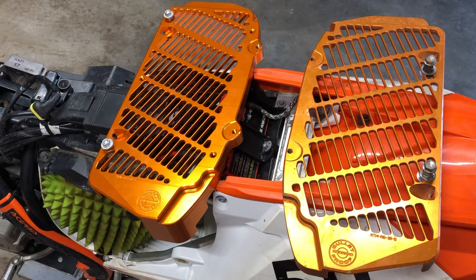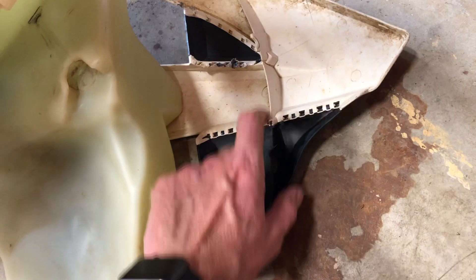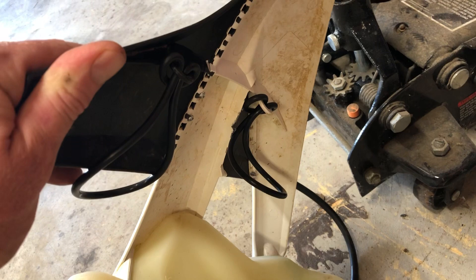That's why I ended up with the new version. I'm not real thrilled with KTM's design for my '17 — at least how they attach the radiators to the shrouds — because this happens: the tab that's there is broken off. On this newer one it's still on there, but I just stopped using it because I figured as soon as I hit something it's gonna break off. So I use zip ties.